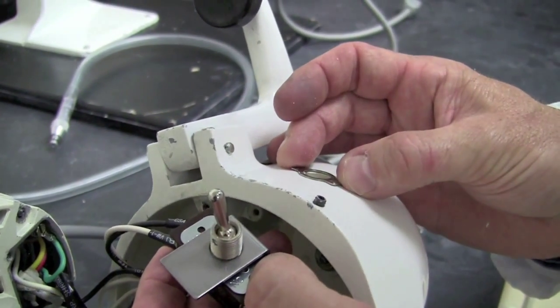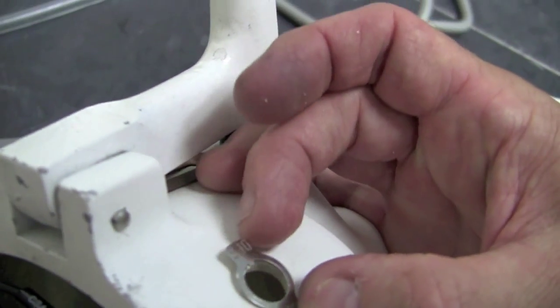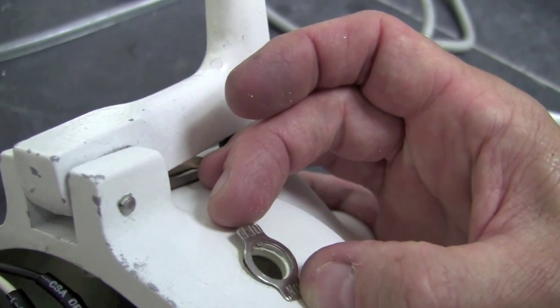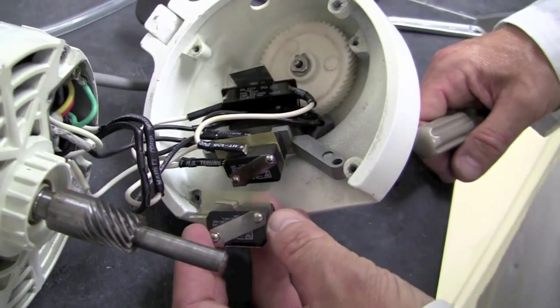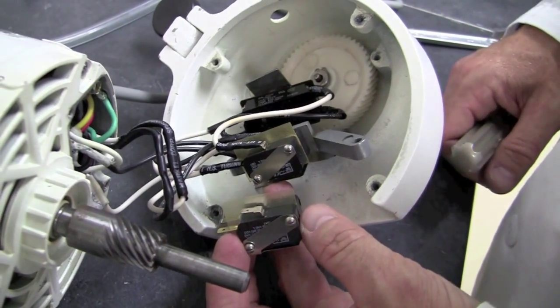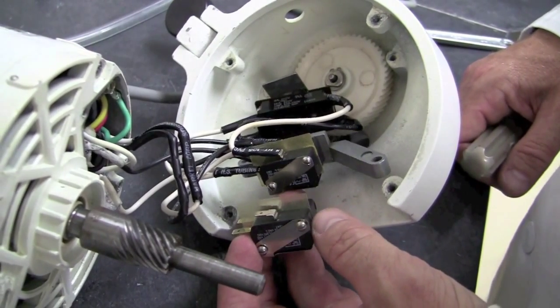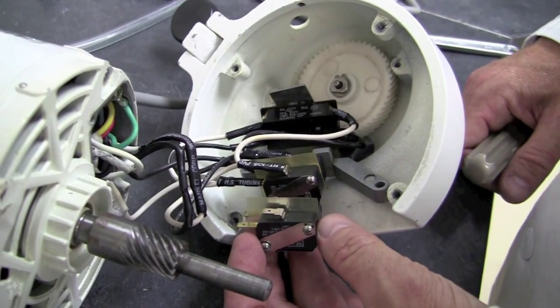It's important to note that with the removal of the toggle switch, the off position of the switch is facing towards the vibrator arm. You can see this on the plate as well as on the switch itself. The first switch to be replaced will be the micro switch or the automatic switch, and it's a good idea to hold the new switch up against the old switch so we have the proper orientation. This will aid in replacing the wires one wire at a time.